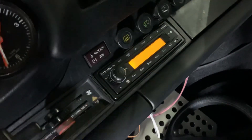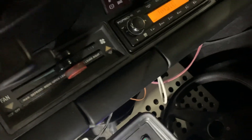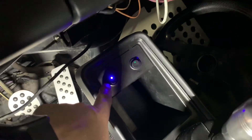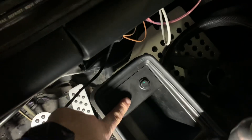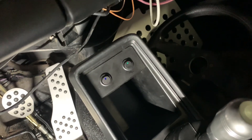But if he's sitting there and wants to listen to his radio, nobody wants to listen to the fuel pump, plus we don't want the threat of flooding the carbs or anything like that. So he can just reach down and hit that little button. Since we wired this all through the trigger wire for the relay, we can use that small switch and have really no impact.